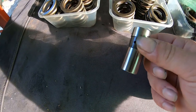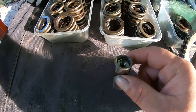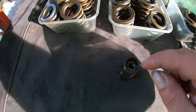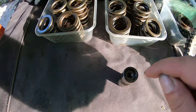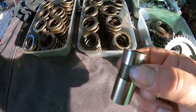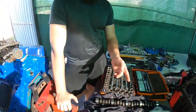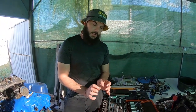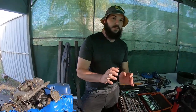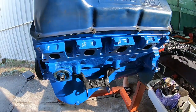A lot of people talk about zinc and oiling issues and incorrect fitment and mismatching components. But the number one reason cam lobes get wiped is people don't look at the lifters when they get them out of the box. You won't get anywhere with a lifter that's not working. If you have adjustable rockers, you'd feel that when setting up the preload. Otherwise, if you miss it and the valve actually hangs when you're setting it up, you'll have big trouble.